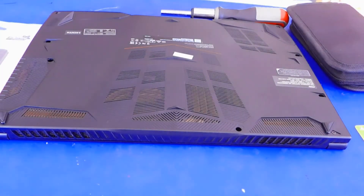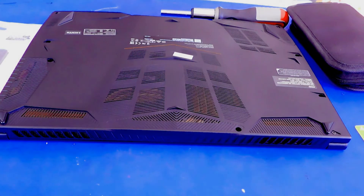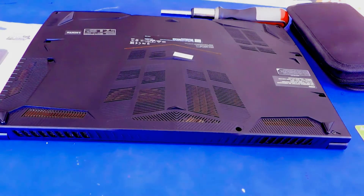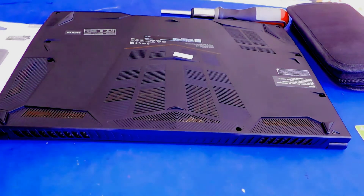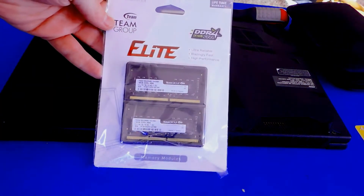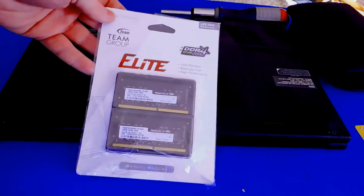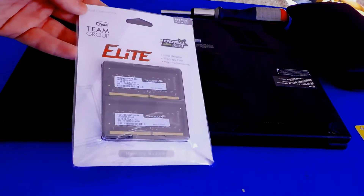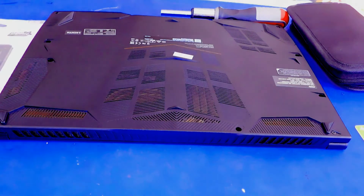Welcome back to the channel. Today's video we are going to be upgrading the RAM in my MSI GF65 Thin gaming laptop. From what I can tell it's pretty straightforward — you need a Phillips head screwdriver, a card or plastic tool to get underneath the crevices for undoing the clips, and of course you need your RAM. For this I'm going with the TeamGroup DDR4 2666MHz 16GB kit — this is actually two 16GB sticks for a total of 32GB. It had good reviews and was about a hundred bucks, which is a pretty decent price.